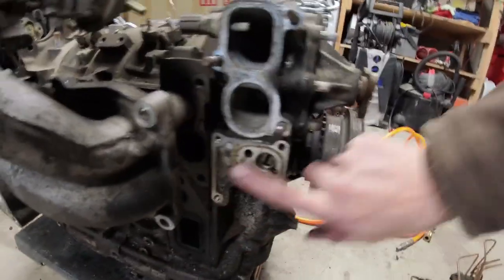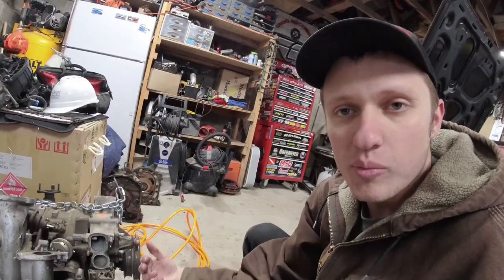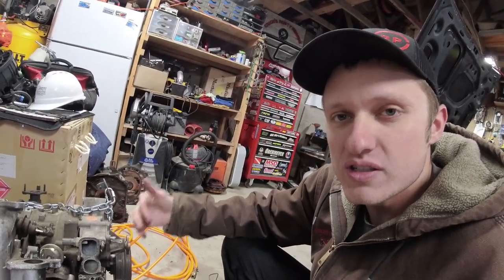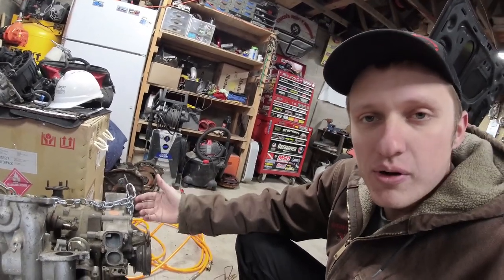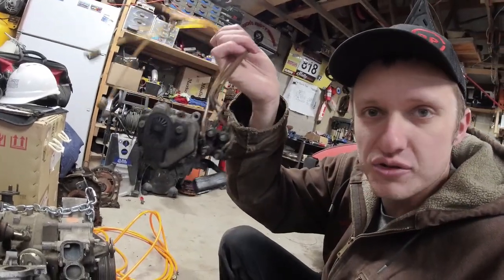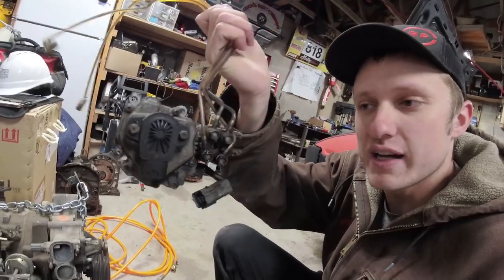Now, on the front cover where the oil injection pump mounts right here, there's a port, and that's what allows this to accept pressurized oil from the oil pan. So your RX-8 is going to burn oil throughout the course of its oil change lifespan, right? If you're going to drive 3,000 miles, it might burn a quart of oil. You can take this system, and in the tune of the computer, you can plug a laptop in, and you can turn the duty cycle of this pump up, thereby injecting more oil into the system.